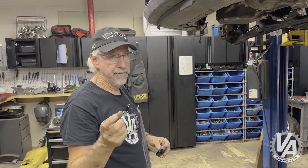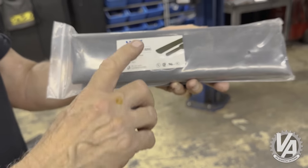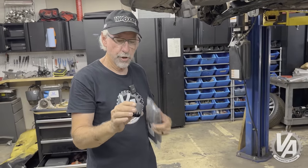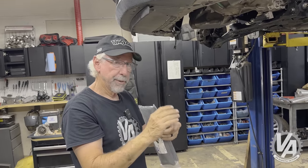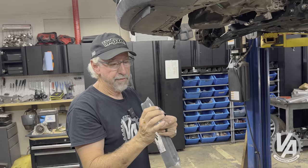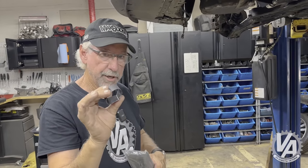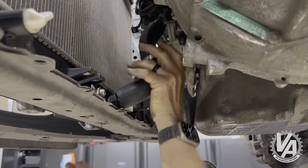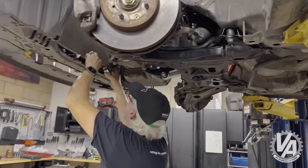We're using the stock radiator on this. The radiator outlets on the Fit are small — about inch and an eighth — and our outlets on the engine are inch and a quarter. The way we get away with that is we use a shrink tube called XHF that has glue inside of it and it shrinks down three-to-one. We cut off a piece, slide it over, use a heat gun to shrink it down, and that sizes it up so we can put the hose on. The glue keeps it from leaking — I found that without the glue, sometimes when the shrink tube gets hot it moves a little bit. Using XHF with glue gets us really close to the inch and a quarter, and we use a worm clamp rather than a spring clamp to hold it down tight.